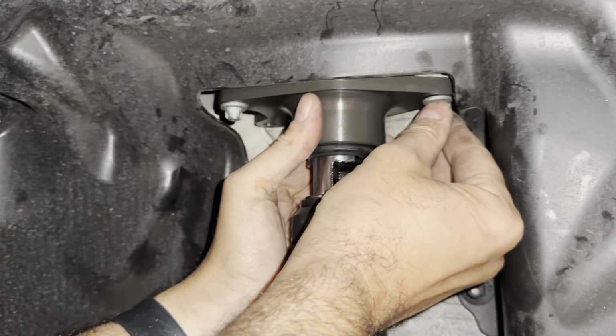So the coilovers feel good. I tried a bit with the dampening settings. I stiffened them up compared to what they recommended, and didn't really notice any difference, to be honest. There's a big dip in the major turn after the main straight on this track that unsettles pretty much every car. It wasn't too bad on this.